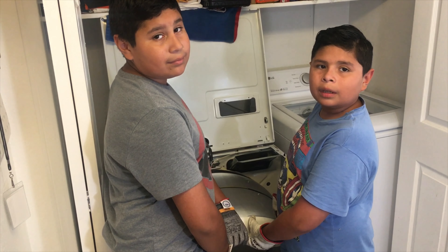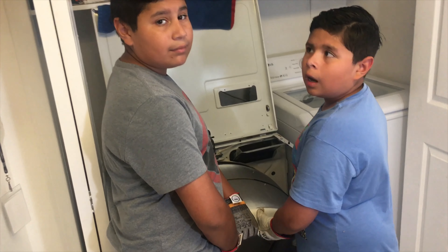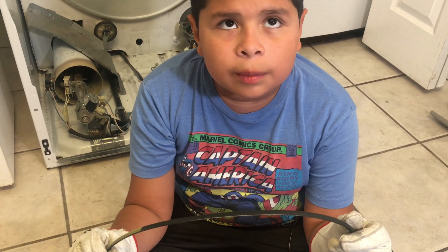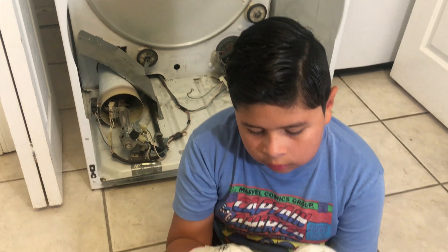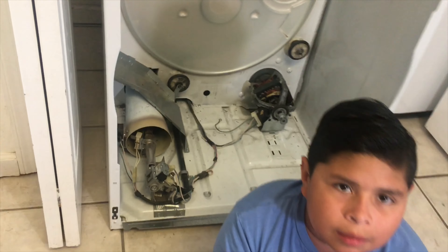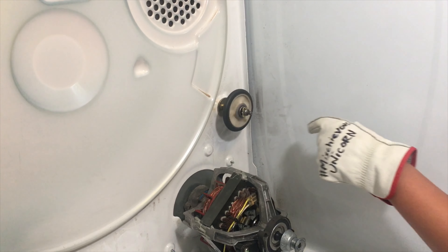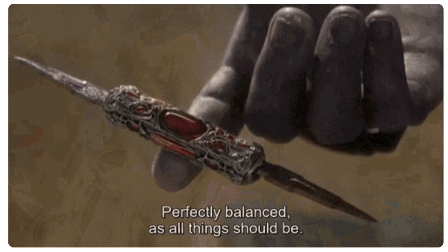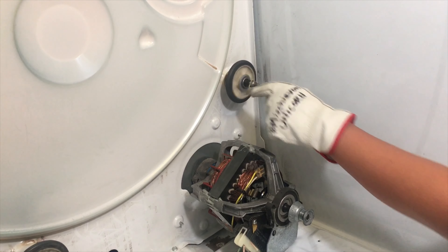You're going to need to pull the belt past the nut. This part is going to take a lot of muscle so you should get some help — it goes up and out. Once you've pulled the barrel out and taken the belt out, you should inspect your belt to see if it's broken or has any cuts on it. Now is a really good time to inspect for any excess lint, and make sure to check behind the wheels so there's no gunk or hair buildup.